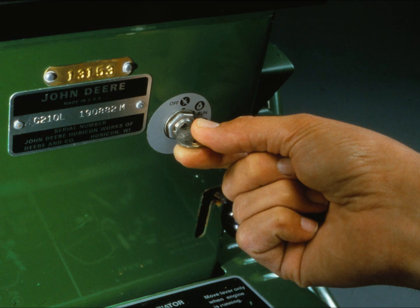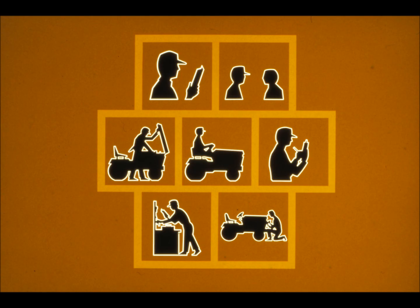One final word of advice: if you have a charging system problem, don't rule out other systems. For example, an untuned engine that requires a lot of cranking to start could be wearing out the battery. The seven-step diagnostic method works with charging system problems as well as problems in other systems. By using it, you should be able to take care of a problem the first time you tackle it. With this method, you have the key to becoming a real pro.